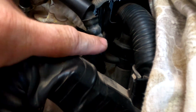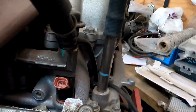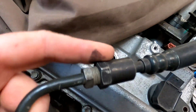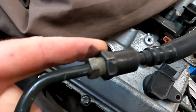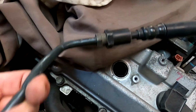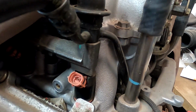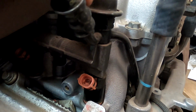You see it's got this ferrule that's been crimped on, so you can just split up each side. Same thing, you will find a barb underneath. There's the 3UZ, there's the same barb setup. This one's actually got the proper screw-on fitting on it still. And this is just my test engine, so I just fit a fuel line on here for now. If I was fitting it to an engine, I would split this and fit it directly onto there.